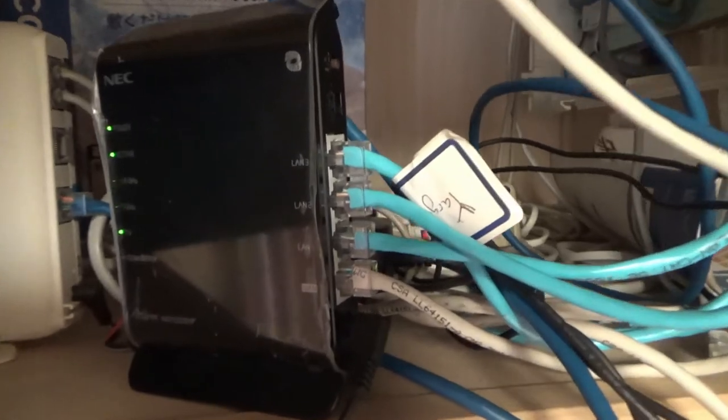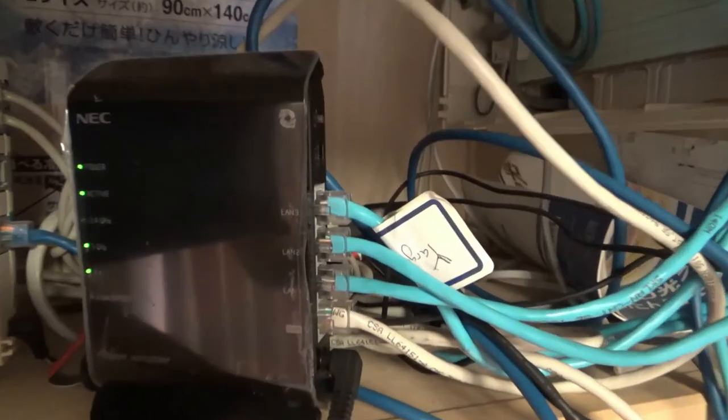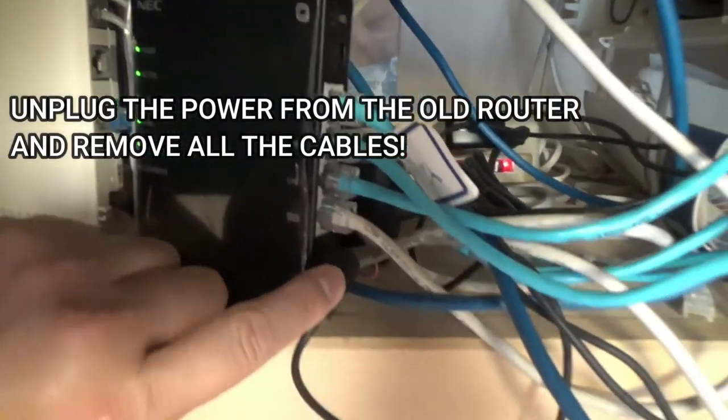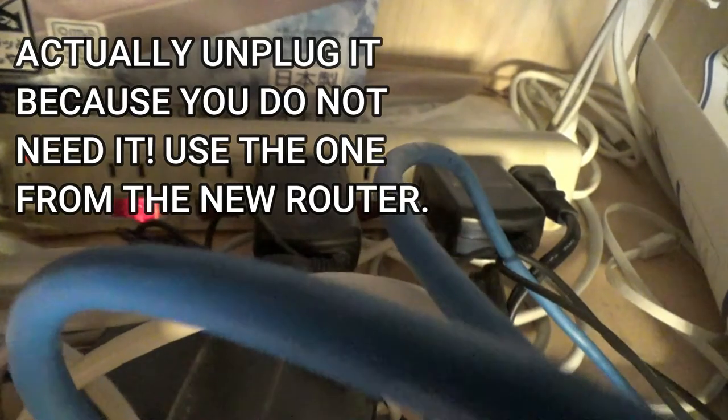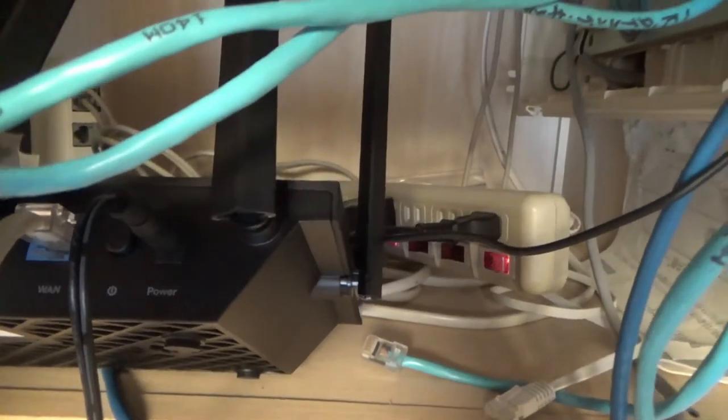It's still hooked up. I'm going to remove the entire thing and replace it with the new router. If you live in Japan, you may have a setup like this. I'll show you how to set it up. My current NEC modem is very old. Unplug the power from the old router, then pull out the plugs, remove the power cable, and switch off the power. I'm going to clean up this area. The LAN cable for my office will plug into the new router. I've got my WAN cable connected to my modem and there is the power outlet.